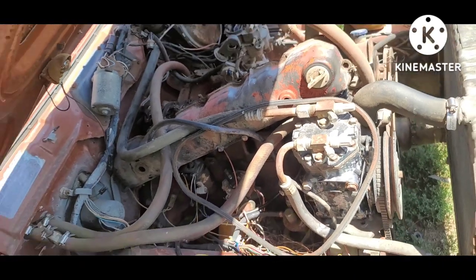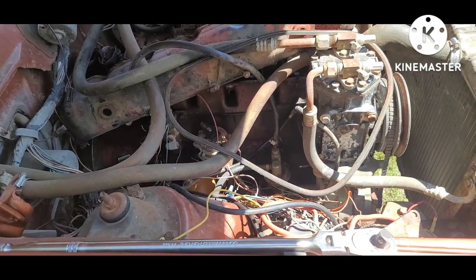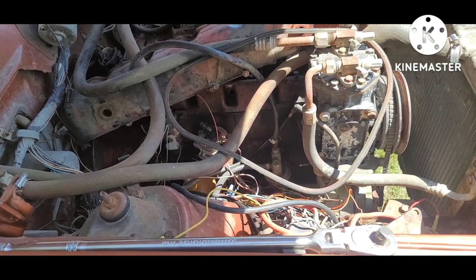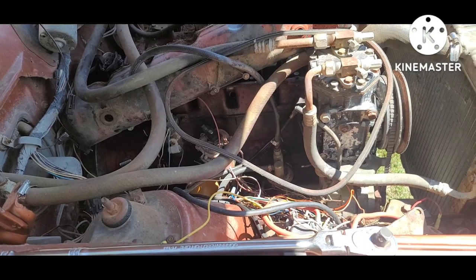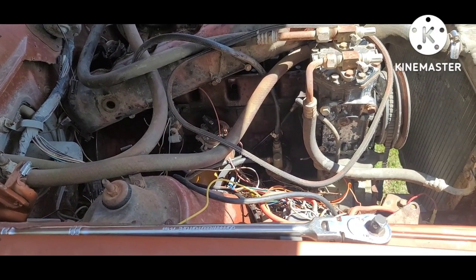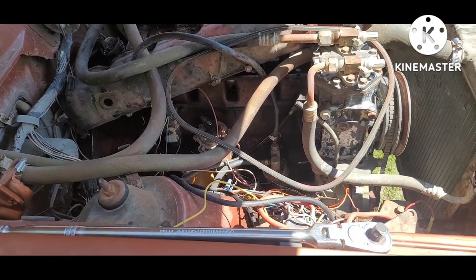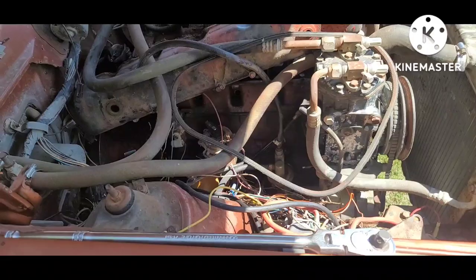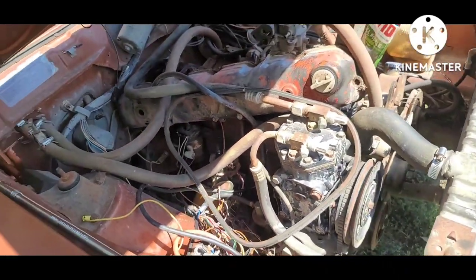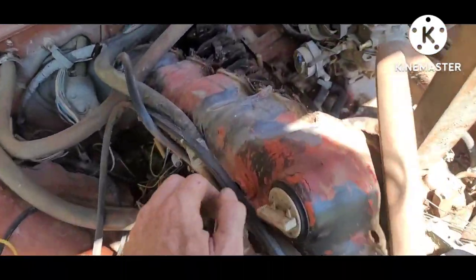So the next thing we did is we stuck a little twig down all 6 of the cylinders to find which ones had passed the oil through and which hadn't. And there were 4 of them that had passed the oil and 2 where the oil was still just sitting in there. So there's at least 2 that are seized. So we pulled the valve cover off.